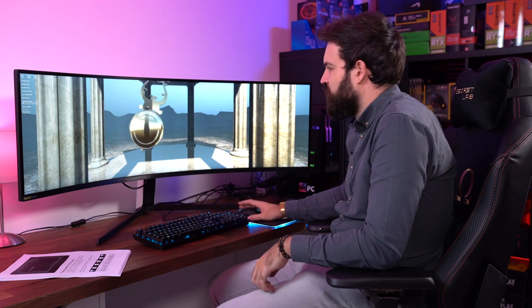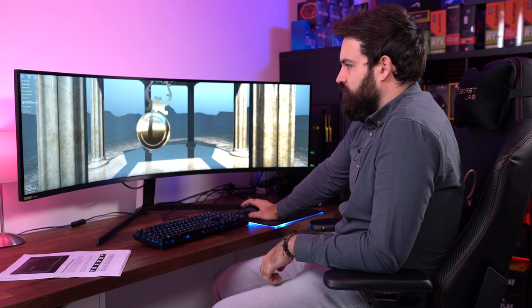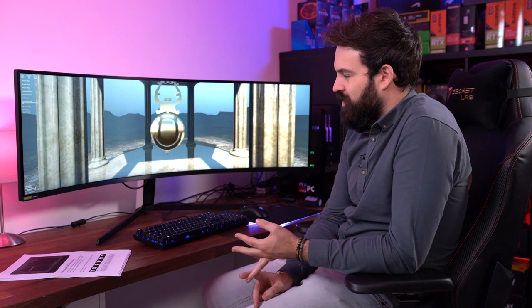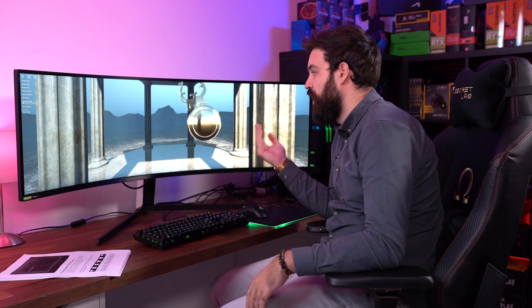And we've just come across a bit of an issue. We can't seem to get G-Sync enabled. We've got the monitor set to 240 hertz now and it's in the maximum resolution. After a bit of research, basically, if you haven't got a 3080, which we're not running right now, we're running two 2080s, you can only do 120 hertz and get G-Sync running. If you want to get the full refresh rate and the benefits of that, you are going to have to run one of the latest series GPUs, so that is worth mentioning.